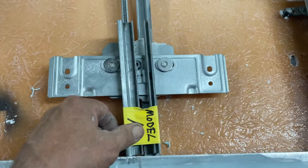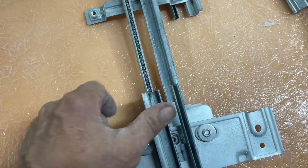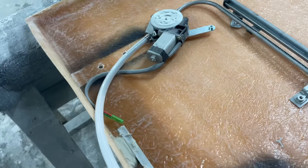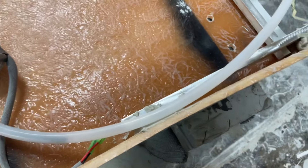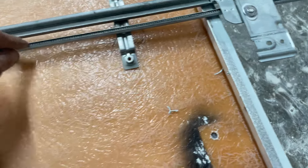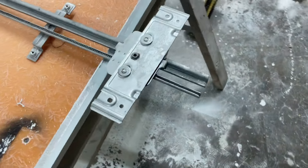So what I'm going to do is roll that window down into the track area here, cut it off right here so it'll be that much shorter. I can bring it over to about there, and the back of it will be sitting right here when we put it in. You want this tube to come up away from the latch so we can stick it up under here — kind of grind that a bit, stick it in. Make sure it's not too long. This little wound spring goes along a gear in here, comes pushing through, and the window goes up and down and clamps onto that. We're going to bolt through here and here, and bolt through right here.